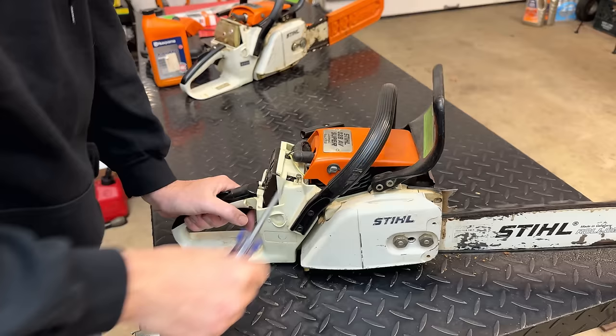And if there is a leak somewhere in the engine, then instead of pulling air-fuel metered through the carburetor, it pulls air from somewhere else outside the saw. So it's getting less fuel, and it's also inconsistent as far as how much fuel and how much air it gets on each stroke. So I'm going to let the saw cool down, and then we're going to do a pressure and vacuum test and see if we can't find the leak.